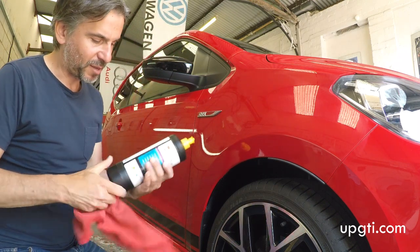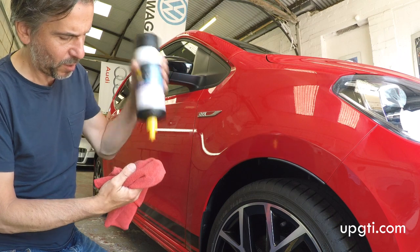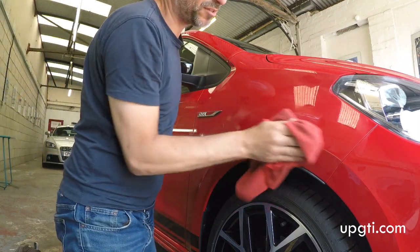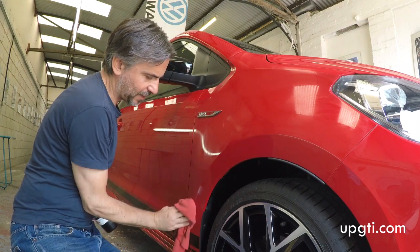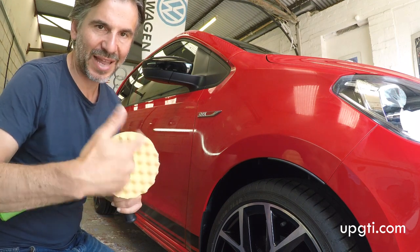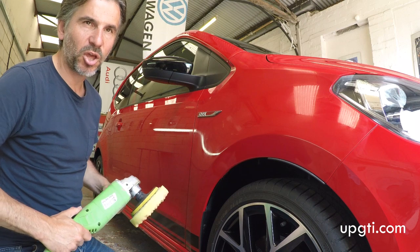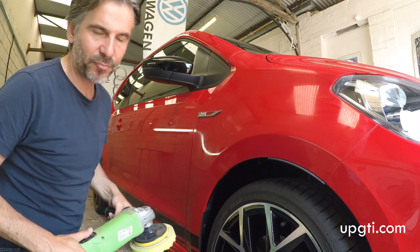What I do is apply the compound — we'll start with the yellow of course — directly to the panel with a microfibre cloth, like so. Just avoid using too much and try not to be messy, because if you put it everywhere you don't need it, it'll start coming out when it rains and just ruin the effects of all your hard work. So just apply it carefully. Then with your polisher — obviously the yellow pad — I've washed this just now to get rid of any grit or dust that might have landed on it during storage. So it's a bit damp as well, which helps with the process. I tend to run it on speed 16, which is quite slow, but you can go a bit faster if you need to. This car is pretty shiny anyway so I don't need to go crazy — this is just to bring the paint up a tiny bit.